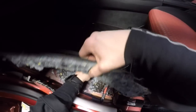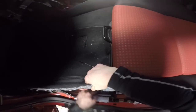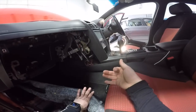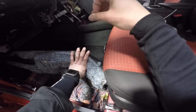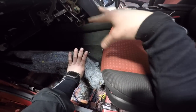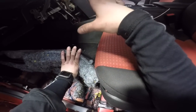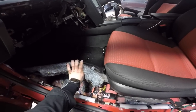So I'm having it about here, maybe 10 centimeters away. It's gonna come along for about 10 centimeters in parallel and then another 5 that way. And then after that, it's away from the power wire. That should be fine because A, you don't wanna be more than a foot in parallel with the power wire. And B, this is a subwoofer, so there's not going to be much noise that a subwoofer can put out that would be picked up on this wire, so it's not as big of a problem as if it were a speaker amp, say. So now that I'm clear of all that, I can just run along the base line along there and out through the boot. But I will do that tomorrow as part of the amplifier wiring up.